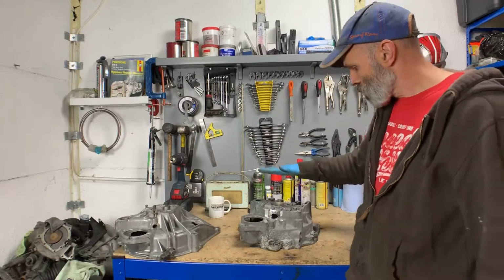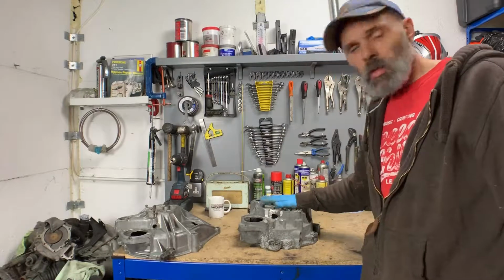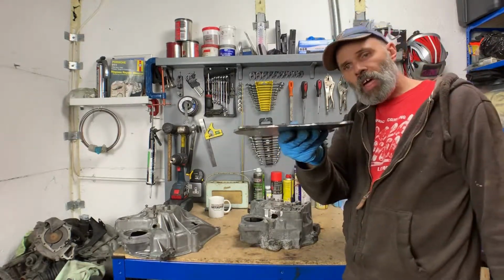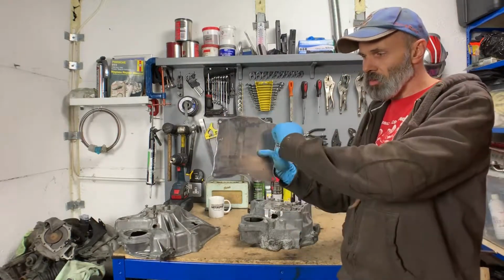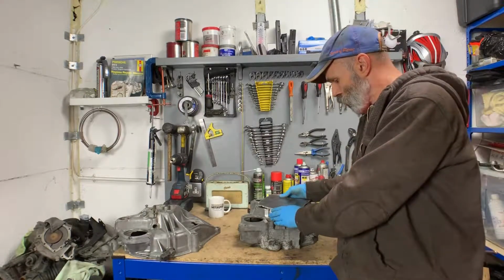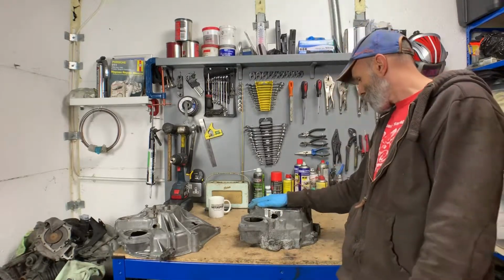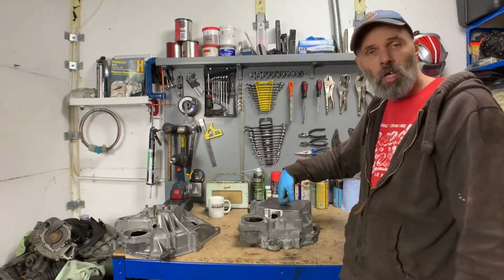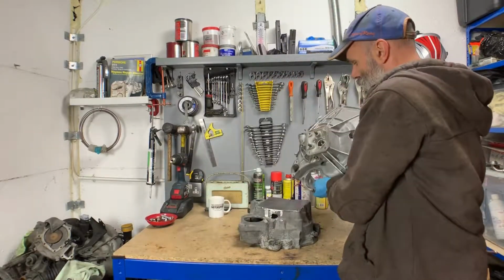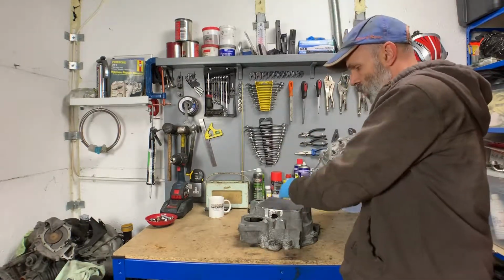Next, obviously this is no sort of a surface to be working on. So the other thing that I've done is take a piece of 4mm steel, and I've basically traced it around the edge, and made this plate which will bolt nice and neatly onto the top there as a cover. From that I've then got a nice flat surface to work with, to basically replicate the Porsche pattern on there so that this will then mount up to the torque tube.